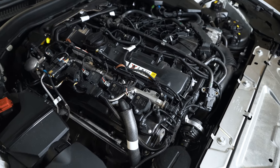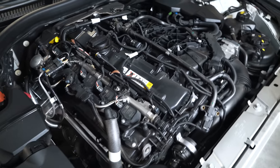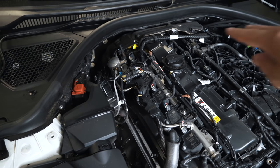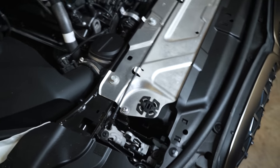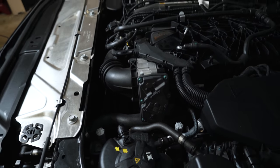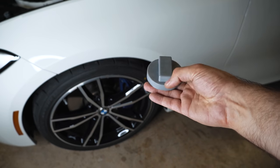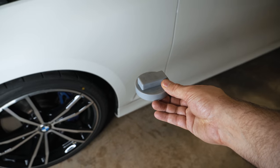It's a decent sized engine bay and looks somewhat friendly to work on — the valve cover gasket should be easy, you're not removing a bunch of cowling like on the N54. Take this cover off and you have clear access to the cooling system. The radiator looks to be somewhat beefy. I'm going to jack the car up and remove the wheel to look at the suspension. I picked up a jack pad adapter — I'll put a link in the description — to avoid screwing up my jack points.